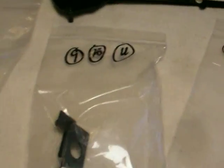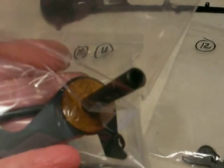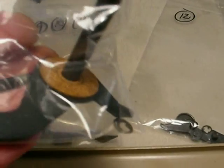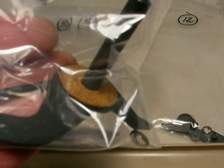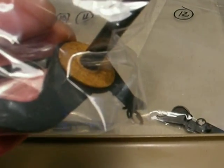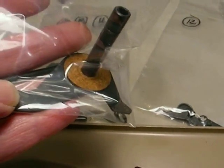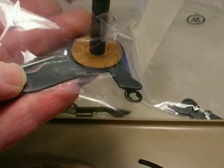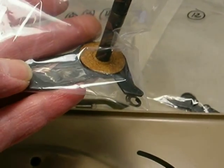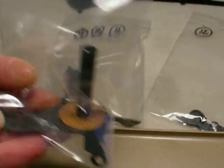The other problem was down here at the bottom of the tone arm. There is your friction pad right there — it's a disc of cork that's permanently glued to this part. The top surface has to be able to be disengaged from the arm when left and right movement is not needed. It doesn't have any gripping power left anymore, but because its integrity is still perfectly good and it's not broken or flaking, I'm going to cover it with a very thin coat of Plasti-Dip put on with a little tiny paintbrush. That will soak in, protect the rest of the cork, and give it a good grip area — so that will fix that problem.